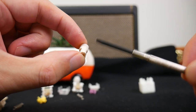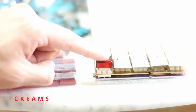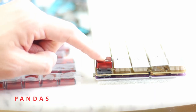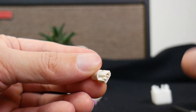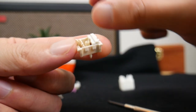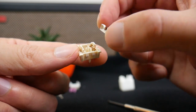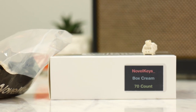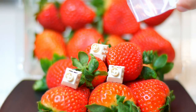The stem starts off with that box at the top — it's really more like a cylinder. This adds extra stability and way less wobble on the keycap, adding to the robust and precise experience. The stem looks larger; I wouldn't be surprised if this is to help protect the internals from dust buildup, which would also make sense in having the metal contacts housed in their own separate housing. The spring is a little heavier than MX Reds at 55g. As mentioned, bottoming out is actually satisfying — not sure if that has something to do with the plastic material being softer or the size of the stem taking up more surface area.